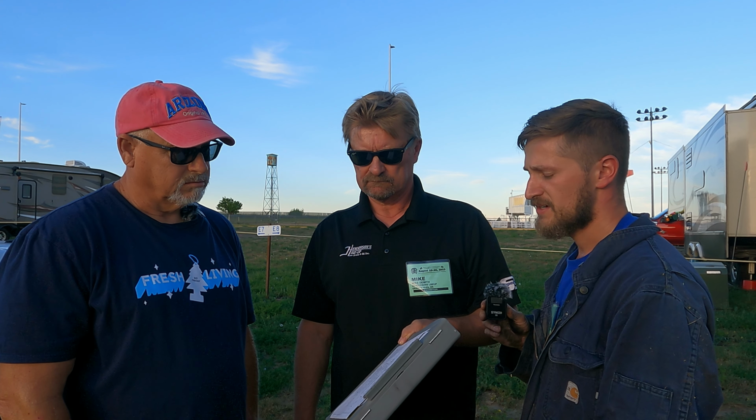What's going to happen? Well, already now getting that much oil in your brake shoes can decrease your braking performance on that. Okay. Do you ever notice it tending to favor the right when you hit the brakes? No, not really. Okay, but that can diminish your braking performance. And eventually, if all the oil leaks out, then you can burn up the bearing, too. Okay. So that really is both a safety and a durability issue that really should be prioritized.